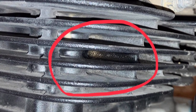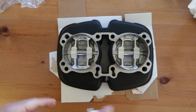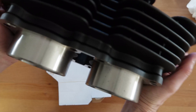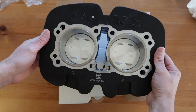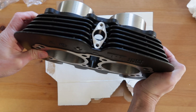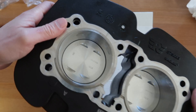I started my research on the internet and eventually found out that it's not that uncommon to have oil seeping out because of porosity in metal castings, which means there are tiny holes or imperfections caused by trapped air or other faults during the casting process. There's loads of info on the subject online and I urge you to look it up — very interesting stuff.